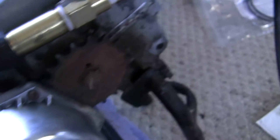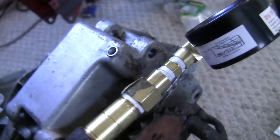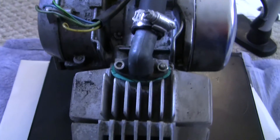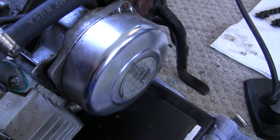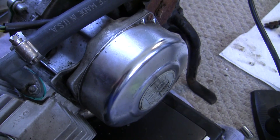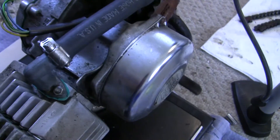When you're spraying around your engine, hit all the normal spots: head gasket, base gasket, intake, exhaust right at the back of the flange, and go around the engine case. We used good Tack and Seal when we sealed up the case — it's resistant to oil and gas, which helps — and of course torquing all the screws in the bottom to spec. If you want to be really ambitious, you could take off your stator and check the stator-side seal right there. The usual telltale giveaway that seal has failed is goopy sludge around it, and mine looked pretty good last time I had it off.